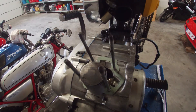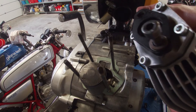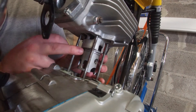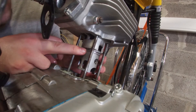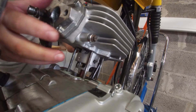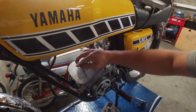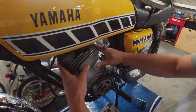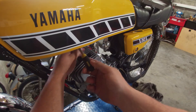And now for the big part — the new cylinder. We've got the cylinder; I've just mounted the exhaust studs and the inlet manifold, nothing too crazy. This piston ring is wrong — wait, is it? Yes. Next up: head gasket. And the cylinder head. Tighten these in a cross pattern and in a couple of stages.